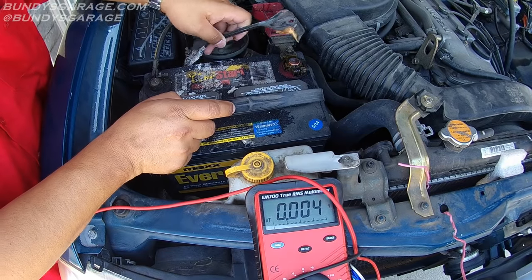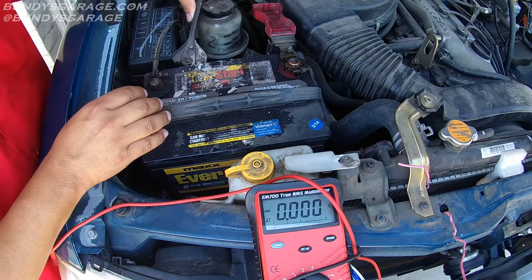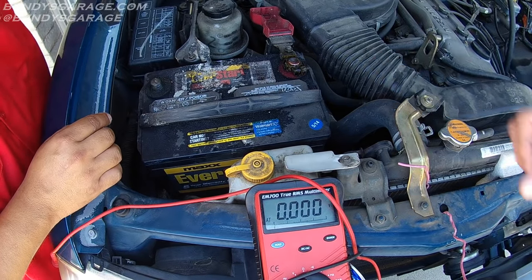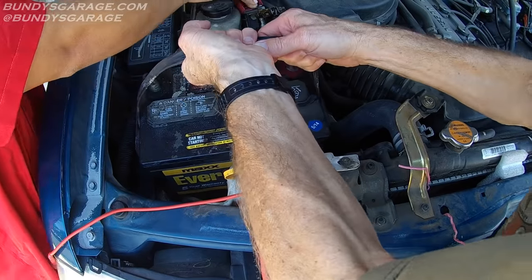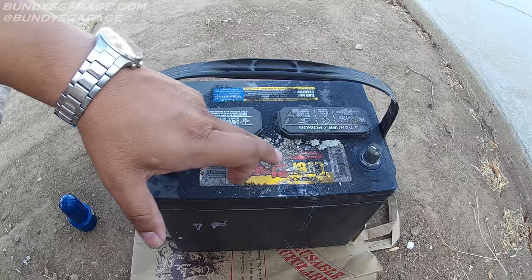Be careful when you take this battery clamp off — it is metal. You never want to stick anything metal between these two because it will fuse-weld itself. I heard a slight arc there. Let's get these out of the way. Our battery has a handle. Got the battery out of the car. You can see all this corrosion, this acid up here.